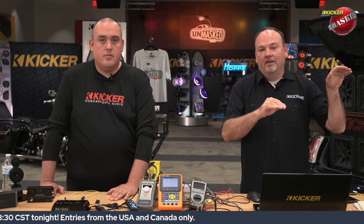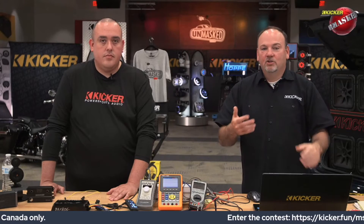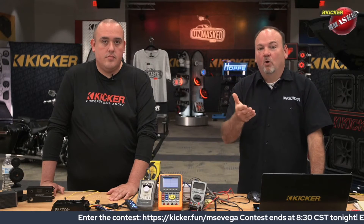It's not about brand, guys. We truly want you to get the best performance out of whatever you're using. If you buy a Kicker wire kit, we don't do CCA at all — everything we do is 100% oxygen-free copper. The difference is if you get one of our value kits, it's just 100% oxygen-free copper. If you step up to the Highline kits, it's 100% oxygen-free copper that's then tin-plated, which gives you additional corrosion resistance for salt marine environments, or even under the hood of your car to keep that wire from corroding and turning green.